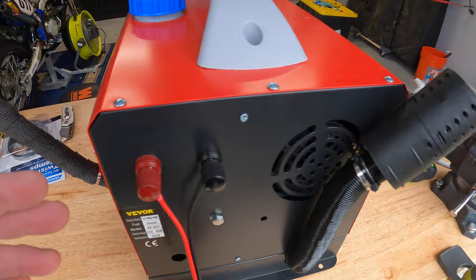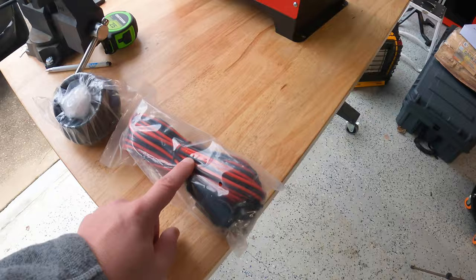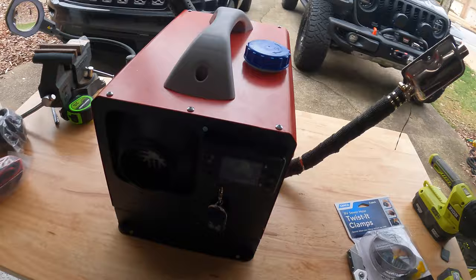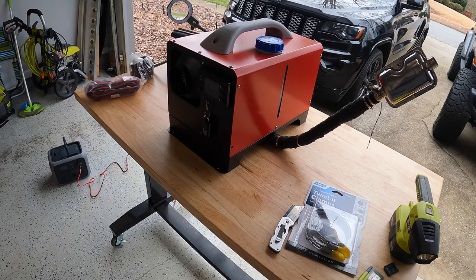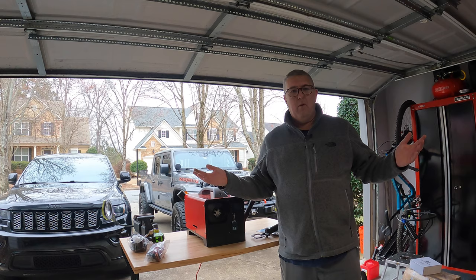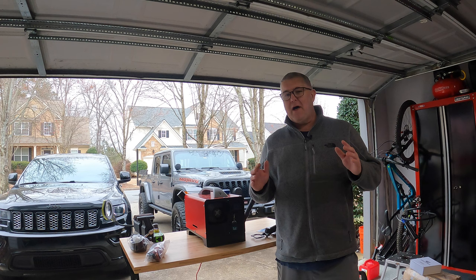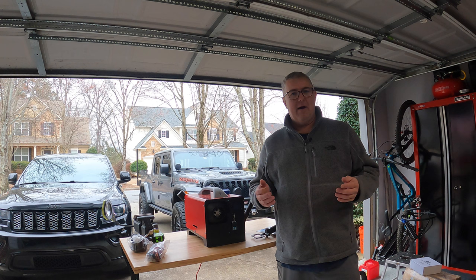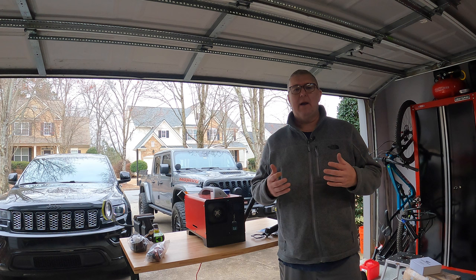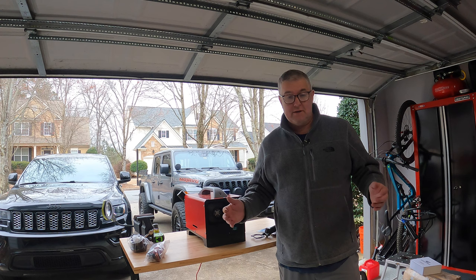I had made some precautions — I was going to extend the power station setup further away from the car, but you know what? This all works now, I'm no longer concerned about it. Upgrading to the ultra quiet fuel pump has really solved the clicking and ticking issue. We did wrap this in fiberglass heat shield — be aware that when you first do that, it does smoke a little as it's burning in. I'm so pleased with it. What a successful video. I'll be honest, I was going into that with not a lot of hope. I watched a lot of videos online and there was a lot of negativity — most people couldn't get rid of this clicking noise. But it's gone. We're going out next weekend — that'll be part four of this series, down to about 20 degrees again. I'll sleep like a baby and not have to worry about this ticking.